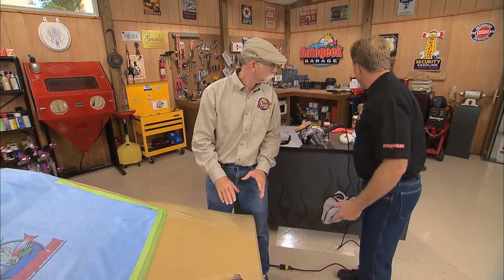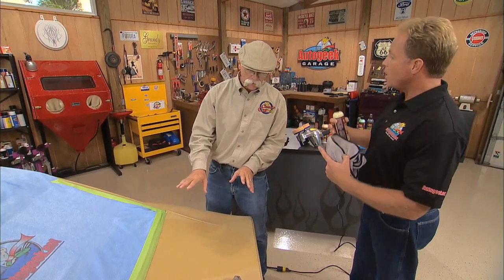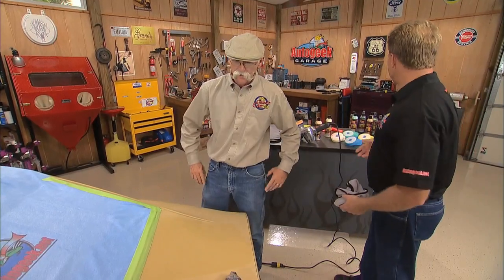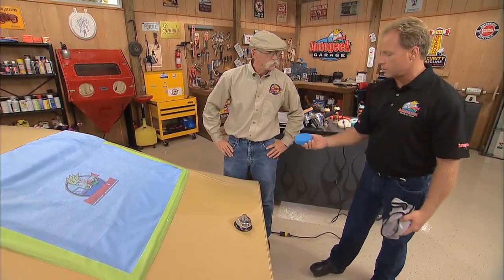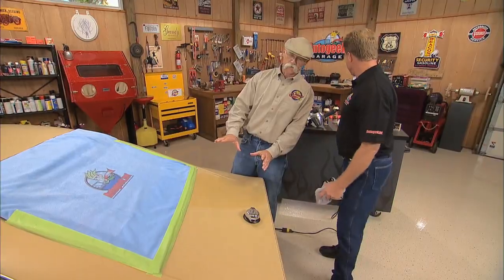So the next thing we'd probably do is jump down to the Pinnacle XMT Ultrafine #1 and a polishing pad. Okay. So we switch pads. Then we want to put the wax on. For that, we'd probably use the Carnauba finishing glaze. And for that, we want to put on a real soft finishing pad. And this machine applies the wax.